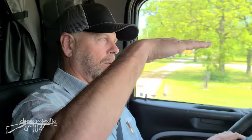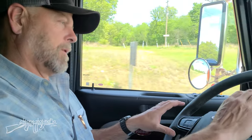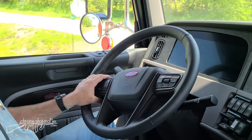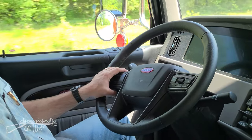One thing we did notice: if you do this job in a shop or at home, you're going to want to take it somewhere and get your steering wheel re-centered, because when we bring the front end of the truck down, it's wanting to turn the steering wheel just a little bit. So right now in my straight position, the steering wheel's cocked just a few splines to the driver's side. You want to get the steering wheel pulled off, re-centered, and put back on.